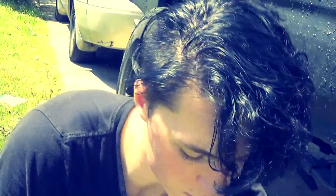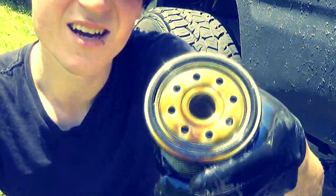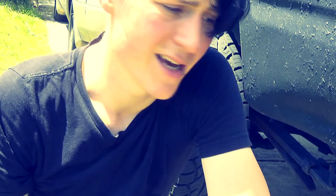One of the next things you gotta do after you take your oil filter off is make sure the gasket — the ring — came off with it. You gotta make sure the gasket came off with it. If you try to put the new filter on with the other gasket still on there, it's gonna shoot oil everywhere and it's gonna be messed up. Don't do that.